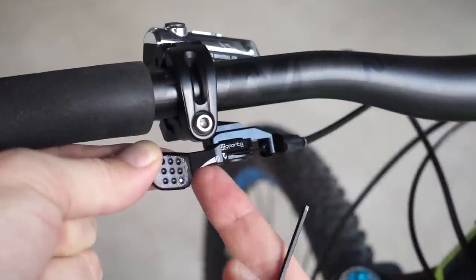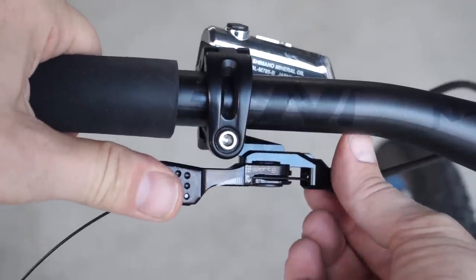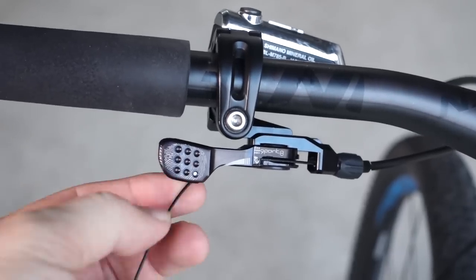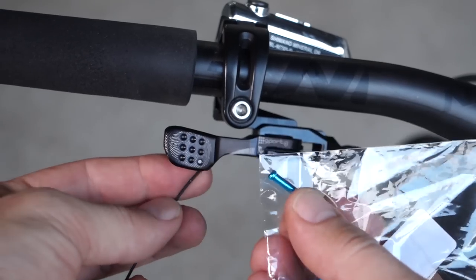This is very shallow here, so make sure you use a good quality hex key so you don't strip it. Make sure that you have a bit of play as well. Finally, trim the inner cable and use one of the fancy colored cable ends that you have in your toolbox.